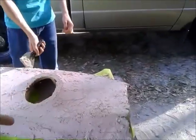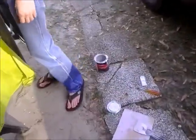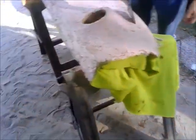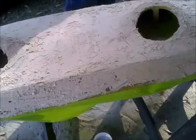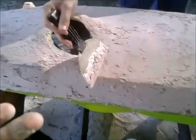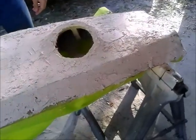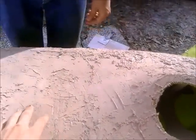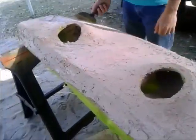Next you'll have to mix the bondo with the hardener. Bondo comes in a can, the hardener is in a bottle. Make sure it's about half an inch thick in a good oval shape, spread it across there — a line across will be plenty. Mix it until it's a solid reddish-pink color. Then put it over the problem areas that have holes or spots that go in, and spread it around as best you can. It looks rough but you're going to sand it down and make it smooth. It fills in the holes and also adds a little structure, so add it to places that need it — like in the middle where it's a bit flimsy.